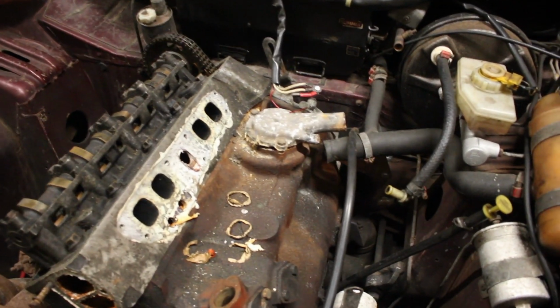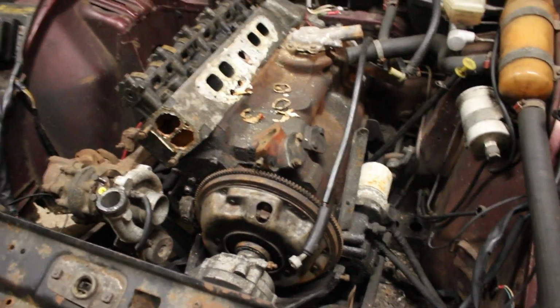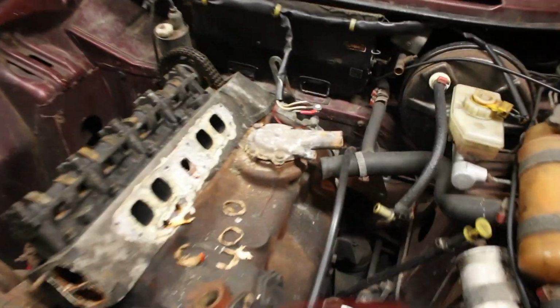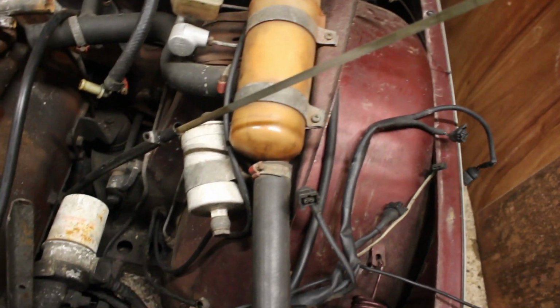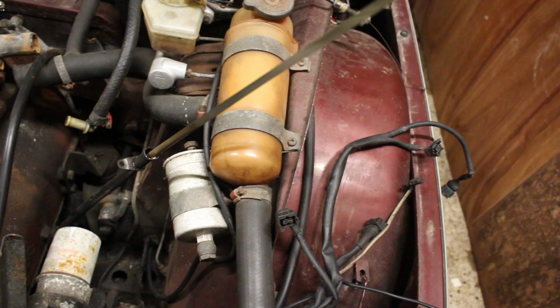I did remove the water pump cover last night because I was intrigued at how it all worked. So yeah, oh, and clutch. Remove clutch as well. And then, yes, drain oil. I mean, dipstick is a bit interesting. That's some milky nastiness a long way up. So I think there's been some water ingress in the engine.